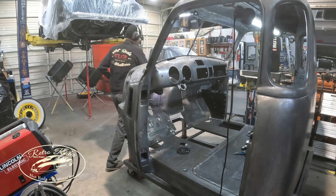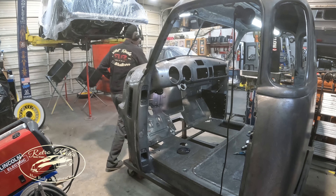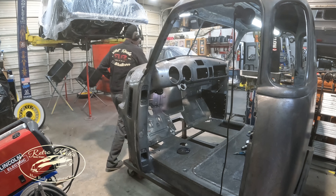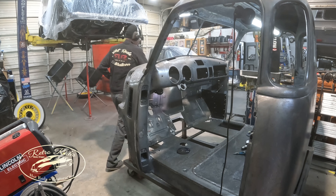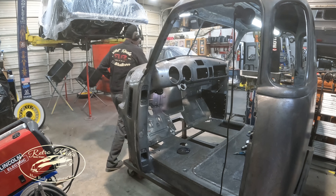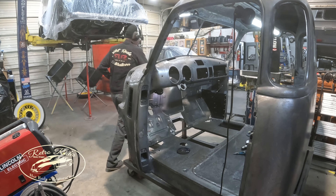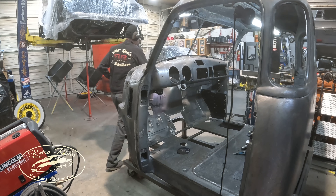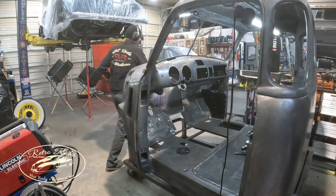So this is Travis's GMC — it's a '47. We're going to start working, like Eric was saying. We've got to go in sections because there are so many things that need to tie in together at a later time. Right now I'm going to be replacing this inner panel on both sides. In order to do that, I've got to separate the inside of the A-pillar, but I want to still keep my structure, so I'm going to keep it welded to the rocker. Then I'm going to fit that whole one-piece floor and toe board — make it out of cardboard first to make sure I get all my measurements correct. I will have to build a flange around the floor and toe board to wrap around this old flange here, and then across the top of the rocker. So I have to first separate the top of the A-pillar to the floor, then replace the inner panels. That's my plan for today.